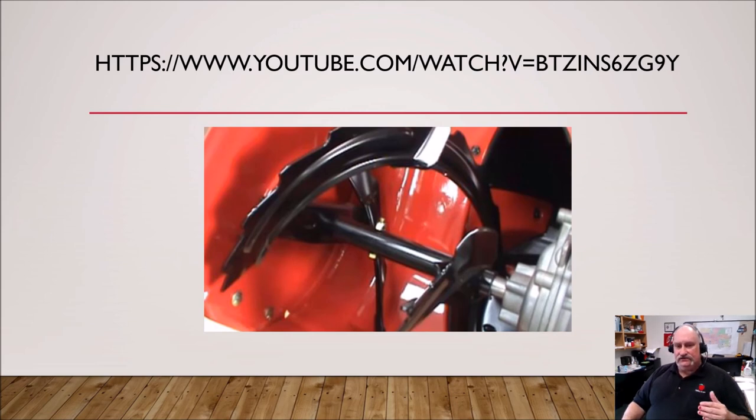Here's why we bring this up: you're out there blowing, maybe halfway through your property or just getting started, and we all know this is going to happen at the far end — so you have to walk half a mile back just to report a problem with your machine. The nice thing about knowing how to replace a shear pin is you'll know what to look for. If you have a replacement shear pin on hand — the equipment manager might drop some off during the season and you can keep them in your desk drawer — it's very easy to install and you can take care of it right then.